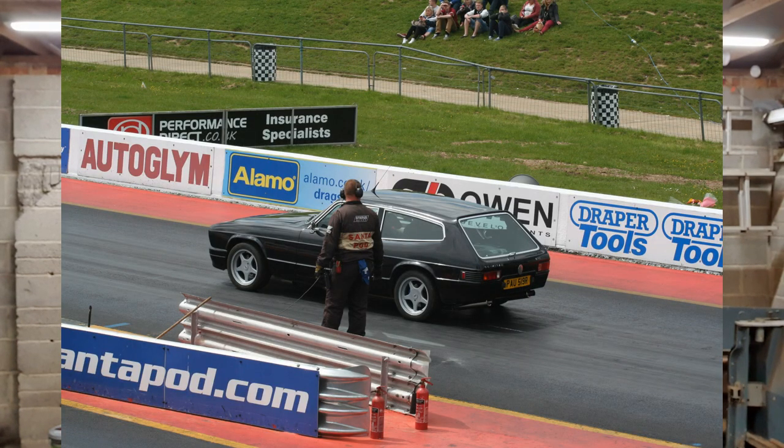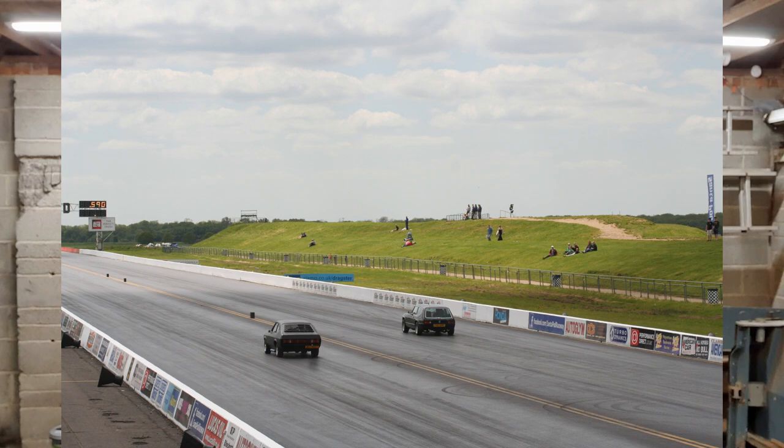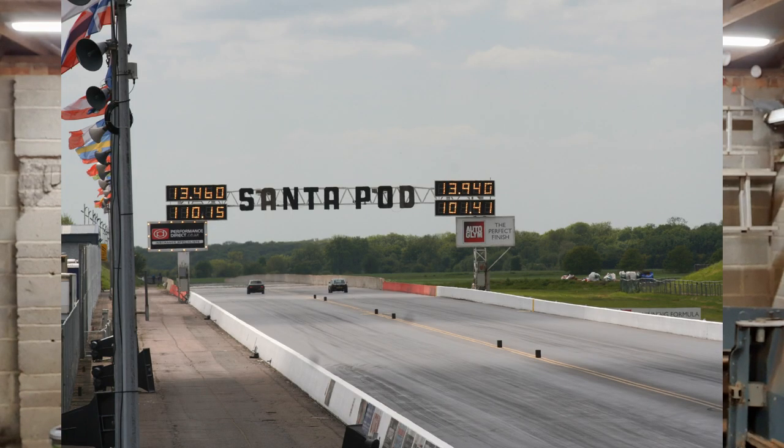That was tuning the Scimitar — that really is the end of the project. I put a new clutch in, took the LPG off, put the new Nankang tyres on, and a number of other jobs to get it sorted. It was finished around ten years ago now and it's done 13,000 miles since then. Now that the LPG tank is gone, it's a car that weighs 1,100 kilos — 1,180 with me in it. I took it to Santa Pod and it seems to do a 13.8-second quarter mile. I believe it's between five and five and a half seconds 0–60.